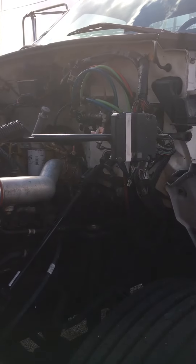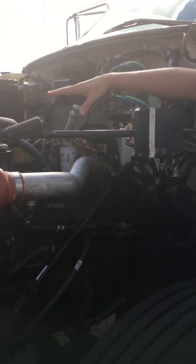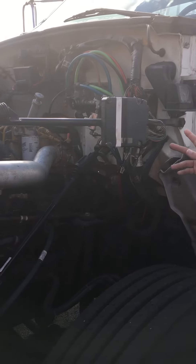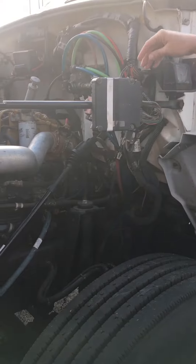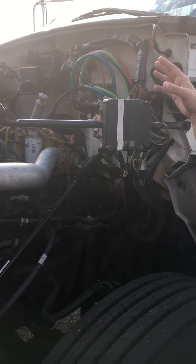From there I'll go to my electrical wiring — not just this one but any wiring I can see. I want to make sure it's all properly mounted and secure, not cut, chafed, spliced, worn, or damaged. I'll make sure all connections are tight, that wiring isn't rubbing against anything, and that no bare wire is showing through the insulation.